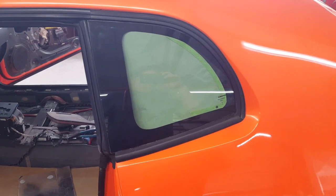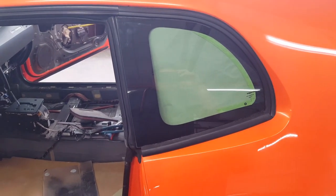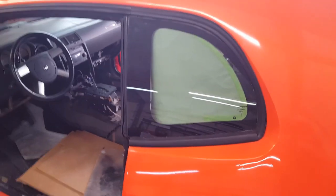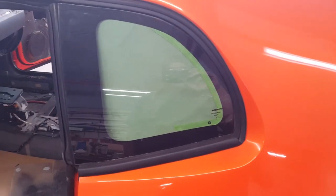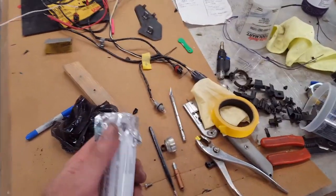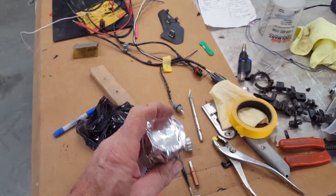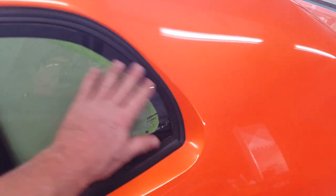It's very thick. So I went ahead and got a pneumatic caulking gun, and it worked really good when I opened the tube at first, but of course a couple months went by. Even though the tube was sealed up as best as I could seal it up, probably the top 1 inch of the tube was hardened up. So what I ended up doing was taking a Sawzall and cutting away the top of the tube and just scooping it out with a stick. And I applied it right to the glass, masked the glass off where I wanted the glue to stay, and then tore the tape off and stuck the rubber and taped the rubber to the car so that it would hold overnight.